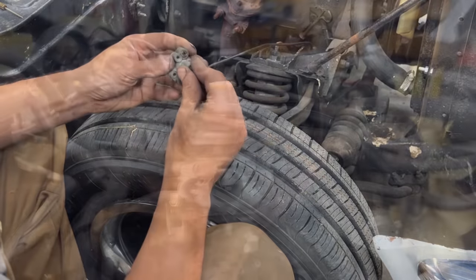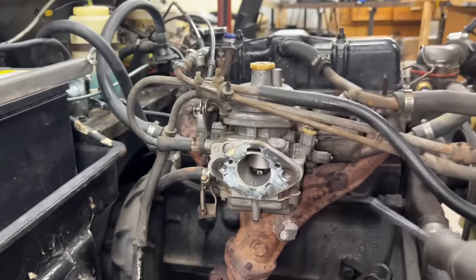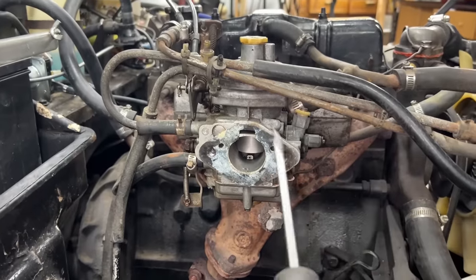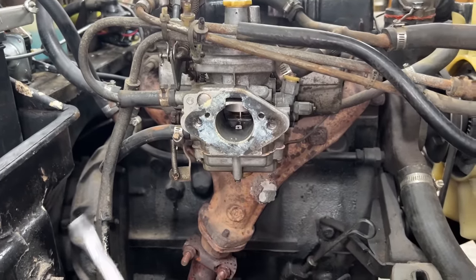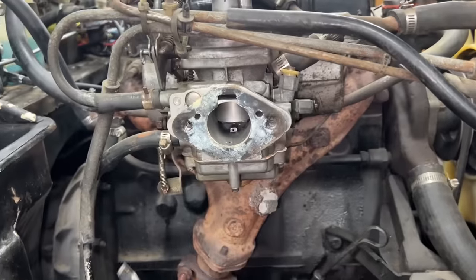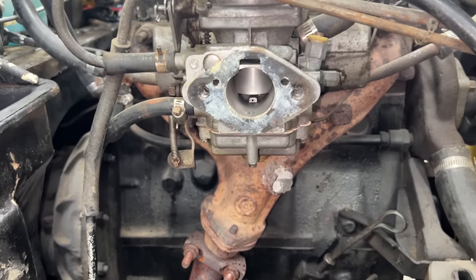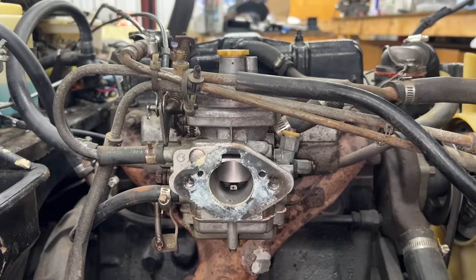Let's put it back on. It is assembled now. We put back the air valve with the needle and filled it up with oil — I use automatic transmission fluid, that's what I like. It goes up and down smooth. I'm surprised because the needle really looked bent, and when the needle is bent it just gets jammed in the jet, but apparently that's not the case here. Let's see how she's gonna run.